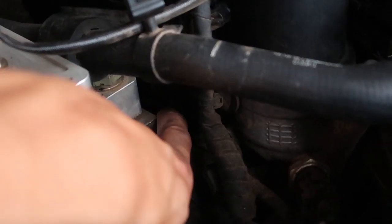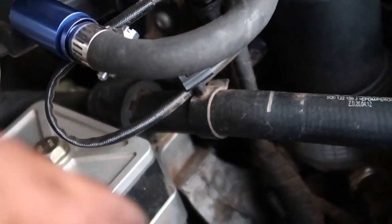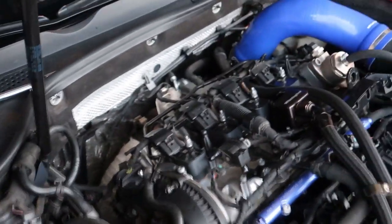The pain in the ass of the job goes to this front lower bolt — there's a matching one on the back side too. The back one is easier because you can go through by your downpipe and use your fingers, but for this one you've got a hand going through here to get one side of the screw and another hand going through the top, then trying to screw it out because you can't get anything on the head. The clearance is very, very tight. You can break them all loose with a 10mm and then use your T30 or fingers to get them out.